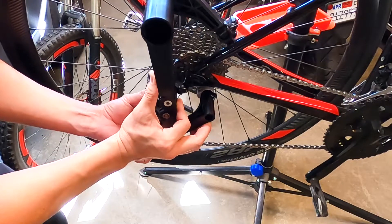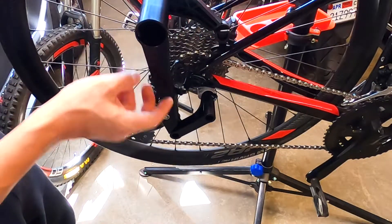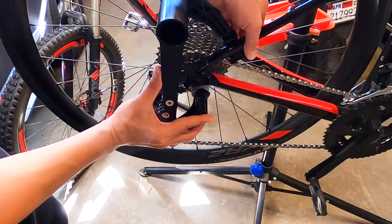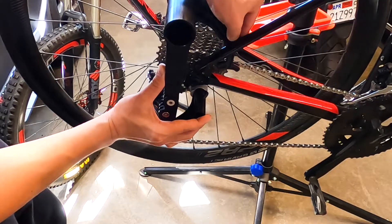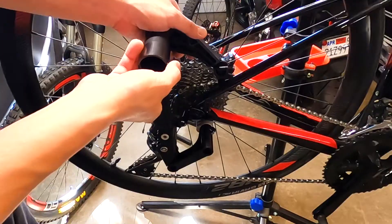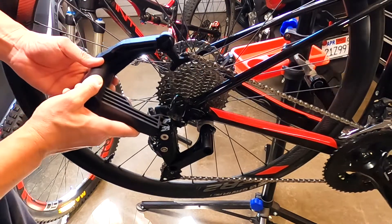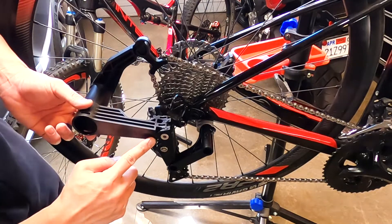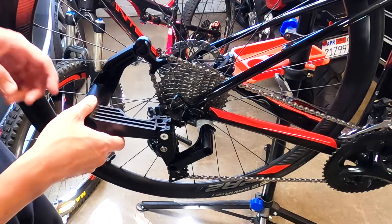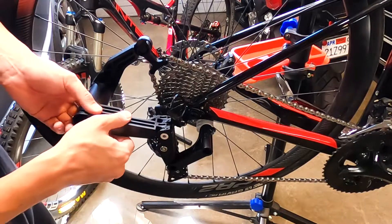Now you just keep going. This thing is pretty much almost all the way — you can't grab the chain yet, but very close. Now this should be the point where you can grab the chain. I have the chain — once you figure it out, it is pretty easy. Pull it back and it's out. You hear it click. It's in position one. There's zero — that's where you want everything in line, the zero position. One and two, depending on how far you want it to go back. I think I'm okay with one, but I want to see if two will work. Nope — it will stick because of chain tension. So you leave it at one.